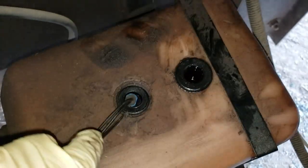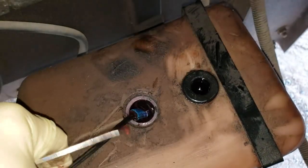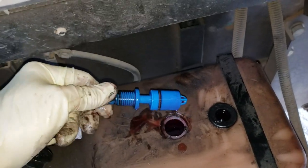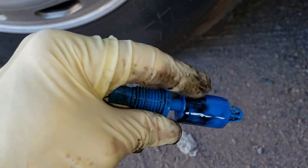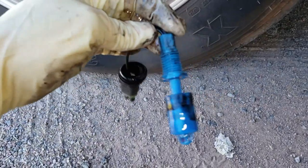Push that down, get the grommet out of the way. I pulled that grommet out, and there's the old switch right there. I don't know if it just wears out or the magnet gets stuck — but it had a line of magnetic dust, or iron filings from the pump motor, probably stuck on the magnet there. But there it is — really the exact same thing.